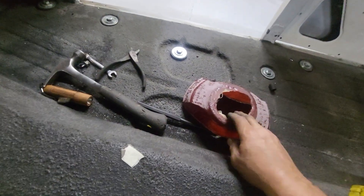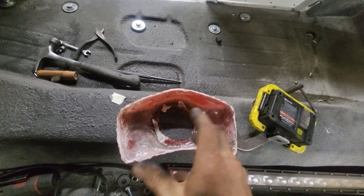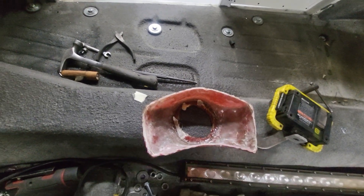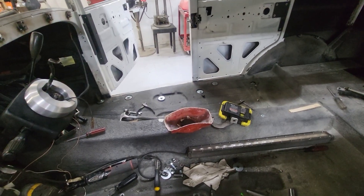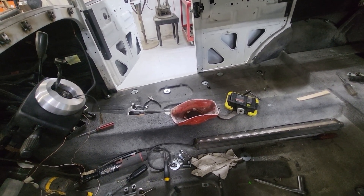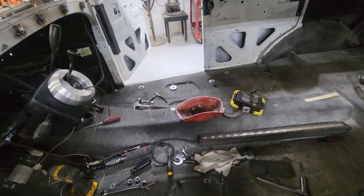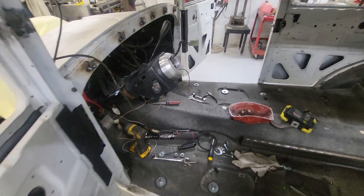The other deal was a fail. This was the end result, but the dimensions went all over the place. It wound up being more work than it's worth to sit here and try to fill it with fiberglass, sand it down, and try to find the dimensions. No harm, no foul. The best way to do that would be to go back, build it up with wood, make a plug, then make a mold, then make the exterior of the piece in the mold. But I like this — it's going to work out really slick.